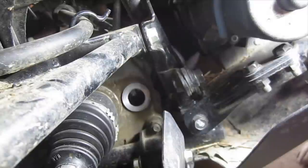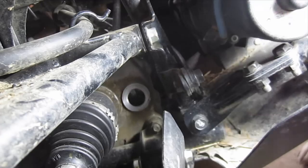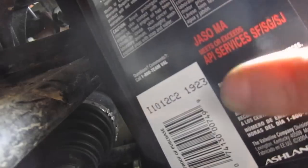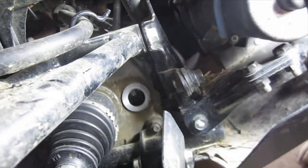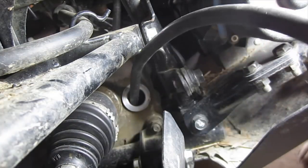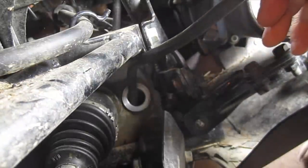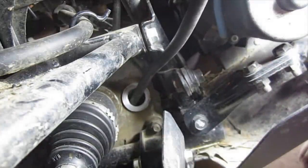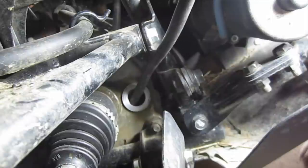If you have a long-neck narrow funnel that would work. What I'm going to use is one of these fill caps and a rubber tube. The disadvantage is that it can take longer to fill, but the advantage is I don't end up with half my oil all over the floor. We're using Valvoline ATV 10W40, which actually meets the specifications listed in the manual — JASO MA, API service SF, SG, and SJ. For those who want to know the actual capacity, it's 0.4 liters, which is just under half of this one-quart bottle.